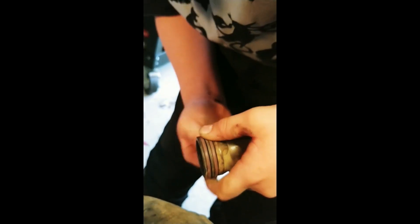Just put it on with your fingers. Get it started on one side and then fold it on around. Don't get that exhaust all over you. About to reuse the old one — that would have been bad. Now we've got this copper crush washer. It's going to go up inside there while we slide this in. See if you can slide that crush washer up in there first, if it'll stay.